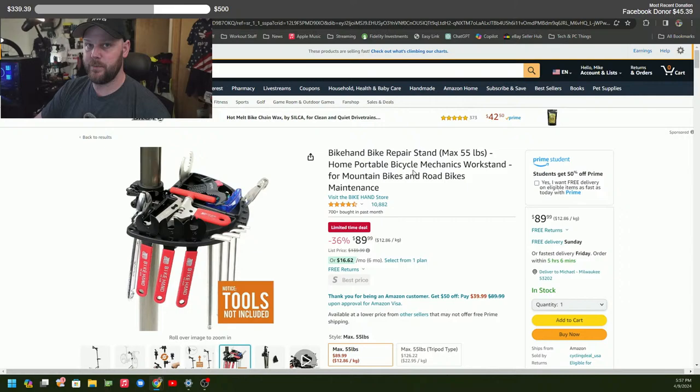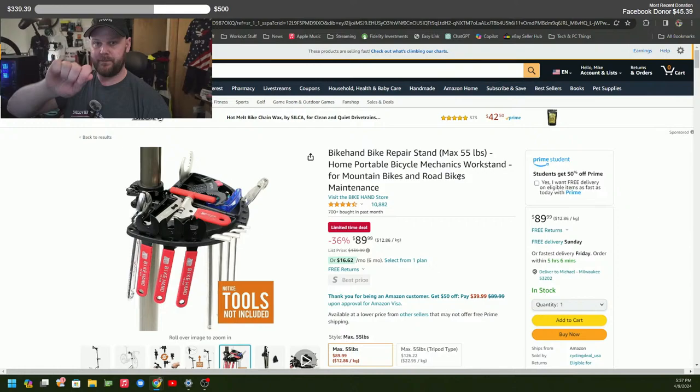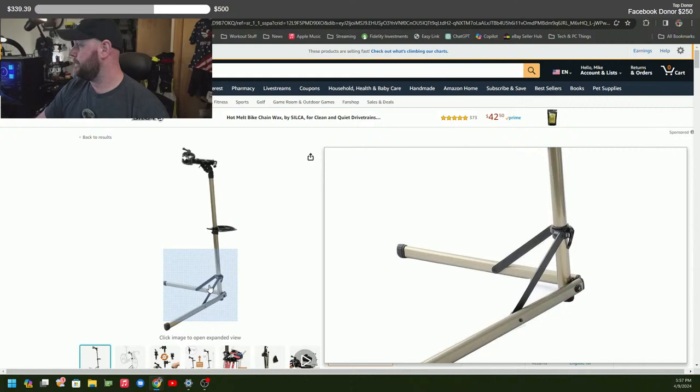So yeah, that's also a very important thing to get if you start working on your own bike, a torque wrench, because everything should be torqued down to a certain amount. If it's not, it can cause irreparable damage to carbon frames, even to aluminum frames, stripping bolts. It can break screws, break bolts, break cables. Basically, at least for that last final part, you don't want to just hand tighten it and hope for the best. You'd be surprised how strong you can be when trying to torque down a part.